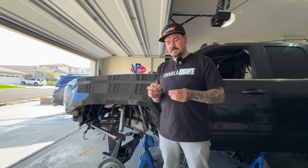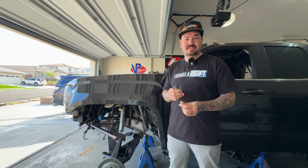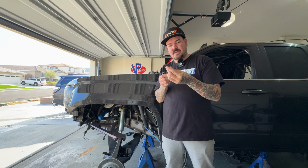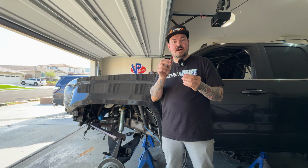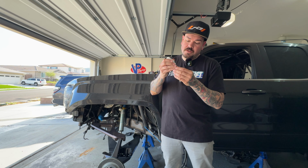So for marking the bottom sides of these bolts, obviously you may want something that's black, but in my case, because my fenders are black, I need something that stands out. So I was able to take a 1/4-inch drill bit right here, and notice this is our riv nut right here, and I'm able to slide that through, and it's not gonna have any give, so you can't get off center. So with that, I've been taking this marking paint right here, and I just throw a little bit on the top,